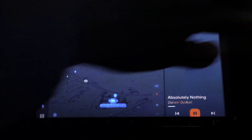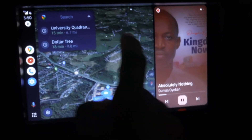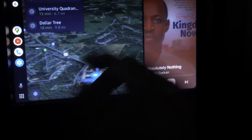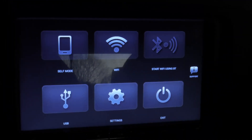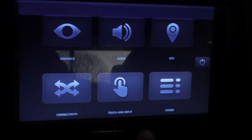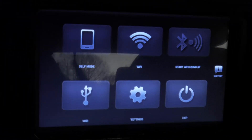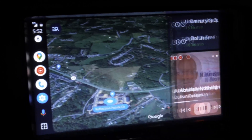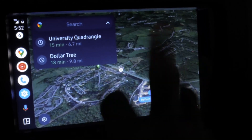It's the same CoolWalk, but the map won't open as full screen at this DPI. I want the maps to open full screen when tapped. So disconnect again and go back to Head Unit Reloaded → Settings → Graphics → Pixel Density. It's currently at 158 — change that to about 200. Go back and reconnect your smartphone. Now when you tap, it will expand. It was just the pixel density, and you can see it's a bit clearer now.